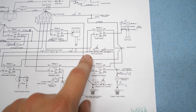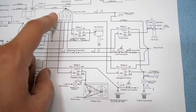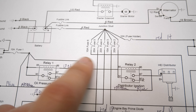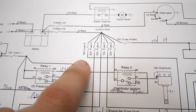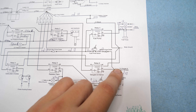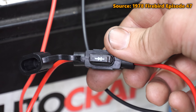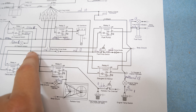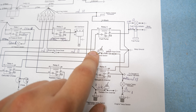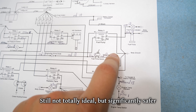If you closed that switch while the circuit was energized, you'd be bypassing the fuses for the entire interior circuit because you'd have two fused circuits feeding into it. So instead of a nice safe 10 amp fuse, you would actually be bringing that whole thing up to 25 amps, which is not really what those wires should be handling. To prevent user error causing issues, we're adding a second diode. This will just be in another of those fuse holders inside the car. With that there, if you flip the switch while the circuit was energized through the relay, this line would be up to a 25 amp equivalent fuse, but there's nothing really complicated here and there's a lot less potential for shorts and problems.